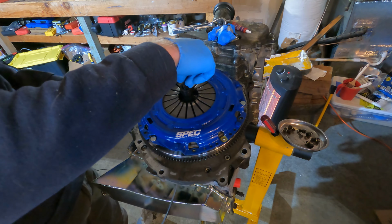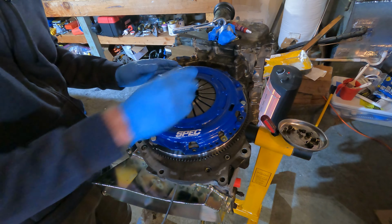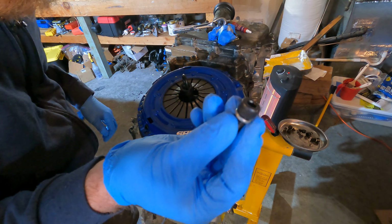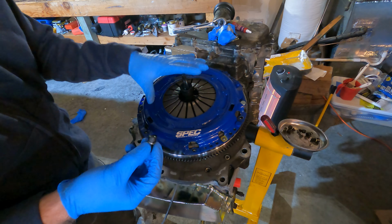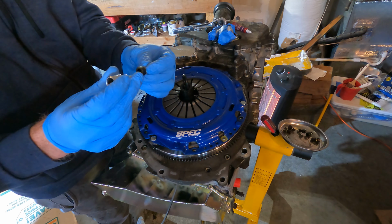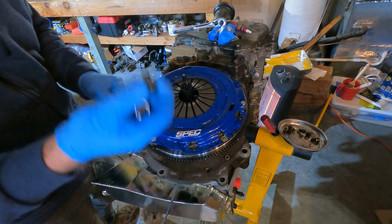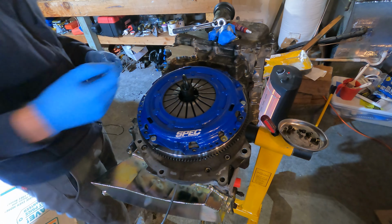So with that in place, it means that my clutch is going to be aligned, my friction disc is going to be aligned to the flywheel, and then we just install the bolts. There's 6 of them. They look like this. I had to pull them off of the, I should really remember what this thing is, the something. These are size 6 Allen wrenches, and not really any torque specs on this. We're just gonna put them in tight, and we're gonna add Loctite onto them as well, like we're doing everything else. So, onward.